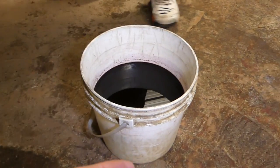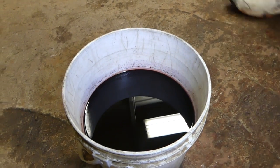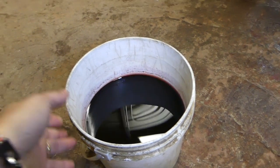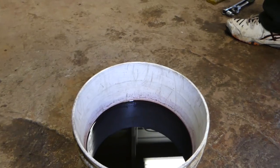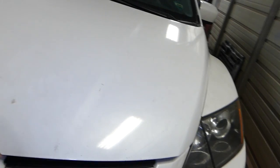That's how you drain the transmission fluid on a Mazda CX-7. We don't have an exact measurement but I would assume that's about 5 quarts — do your research and see how much it takes when you drain it. Because you cannot drain the whole system — no matter what you do, you still have some fluid in the cooler, transmission lines, valve body, and things you cannot drain. So make sure you add the same amount that you drained, and check your transmission fluid level.